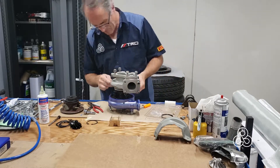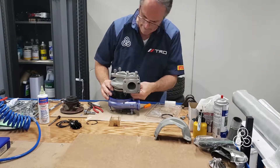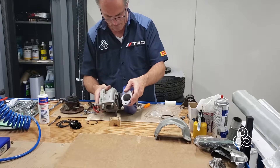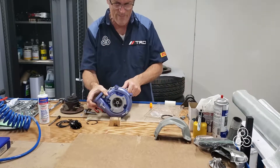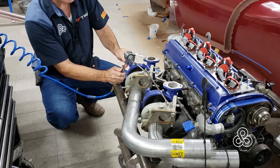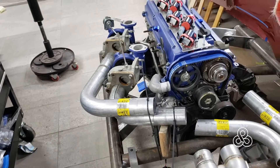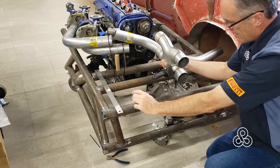There it is — the new clock rotation, about 90 degrees difference between the exhaust input and the compressed air output. Once in position, a locking ring goes around the turbine housing to hold it to the center bearing housing and tighten that up. The peripheral stuff goes back on once it's installed in the engine, as all that plumbing will be new. The pair is ready to go — a quick demonstration of the wastegate shows it works. The wastegate tubing will mount into the tube here, and the two exhaust outputs will come together in a merge crossover, then down to the catalytic converter and exhaust system.